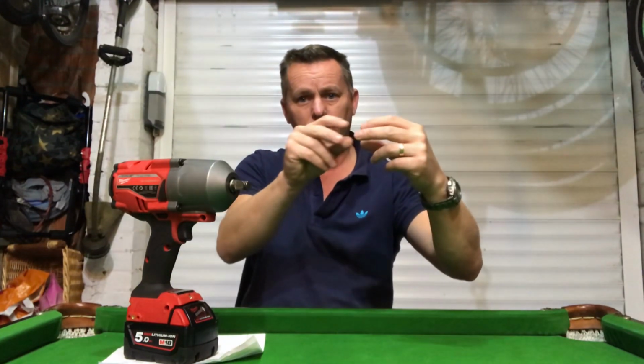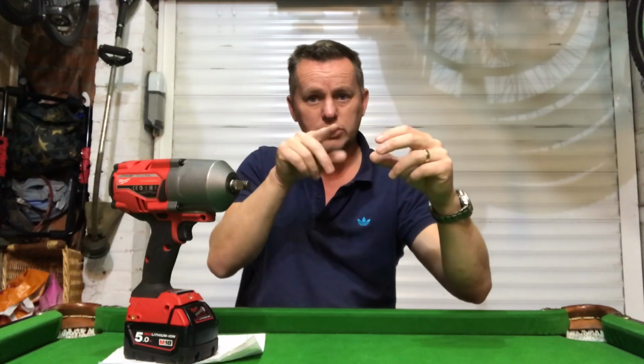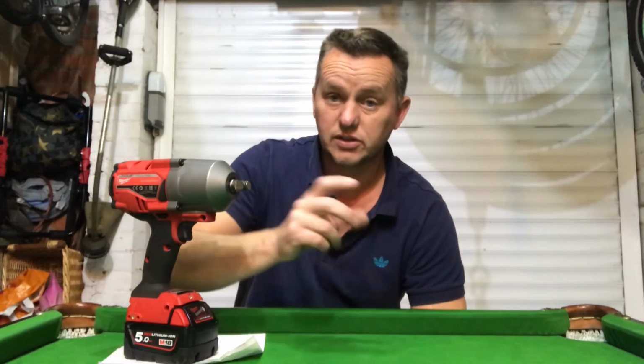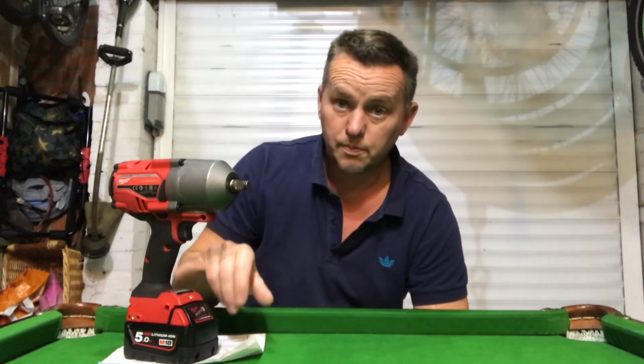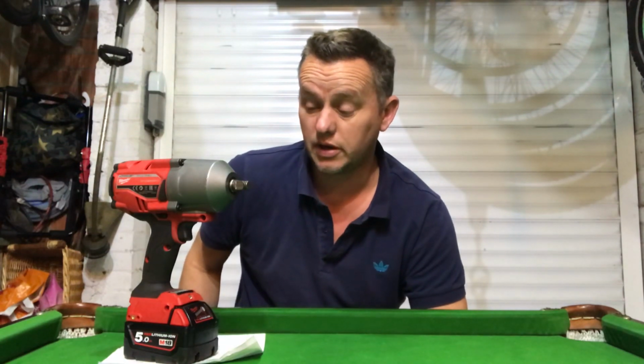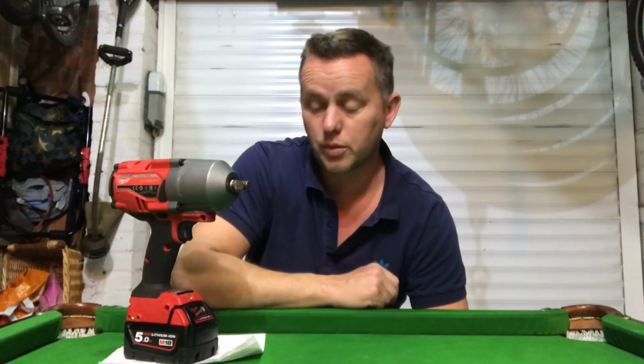And obviously, when you're going through a long shaft, you're losing a lot of torque through it. This was on setting 1 to start with. Didn't even touch the sides. It just weren't having any of it. So I just puffed it up to 3. Wham! Straight out with a puff of rusty dust. Off it come, and it were tight. I thought, I'm just going to put my bar on one of these other ones and see how tight it is. Well, I tell you what, they were tight. They were really tight. This thing whacked them straight off, no problem at all.